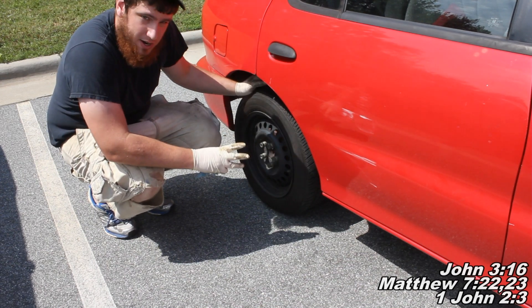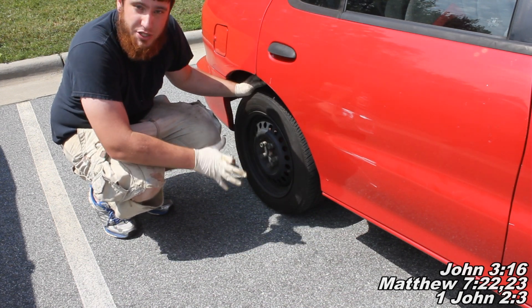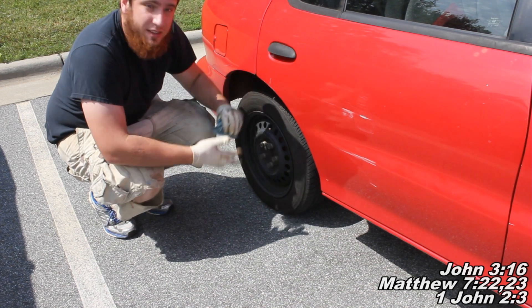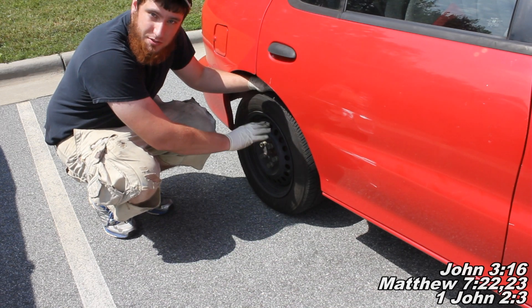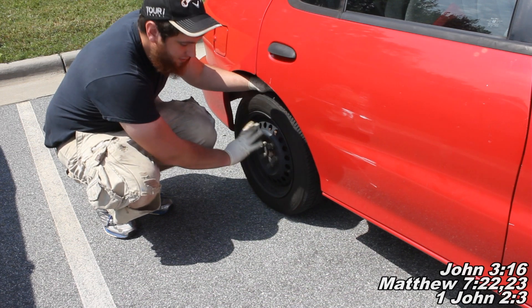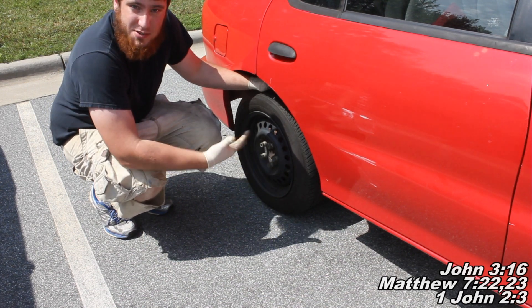Now, there are three different things I've heard. The first one is that you don't have to remove your shoes — you can take sandpaper and sand the tops of the shoes right there. The other thing is the edges of the shoes. Apparently those bite into the drum, and that's what causes the lockup. This is what I've heard.